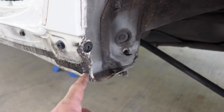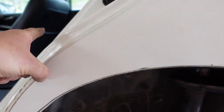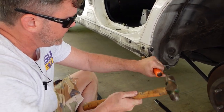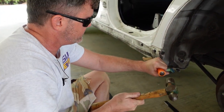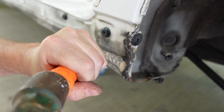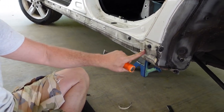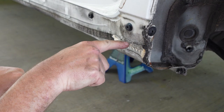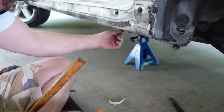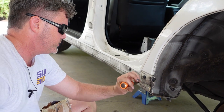The best way is probably to take a hammer and a chisel and just chisel it all the way down. This is where we're going to cut it — not 100% sure on the exact spot yet. On the other car I used a chisel and it wasn't too bad, but I don't know if it's better to use heat or just chisel it off. Here's where all your spot welds are — along the rocker panel. At first I was going to go all the way to the pinch weld, but I couldn't separate it there even after drilling all the spot welds.